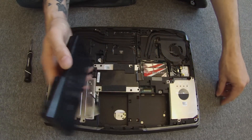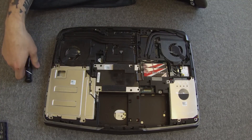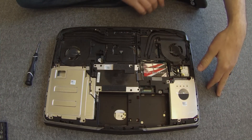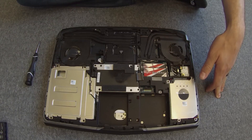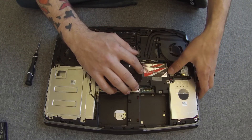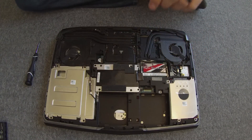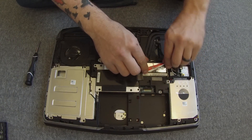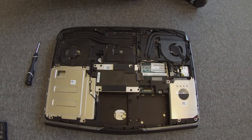As always, keep the screws with the original component so you know what goes where, because there will be a lot of screws for this disassembly. Next we will take out the RAM, because it's the easiest thing to remove. There are two sticks here and the other two sticks are on the opposite side of the motherboard. Just pull the two tabs on the side and your RAM lifts up — same as every other laptop. Same thing with the bottom stick: pull it out and the RAM module comes out.